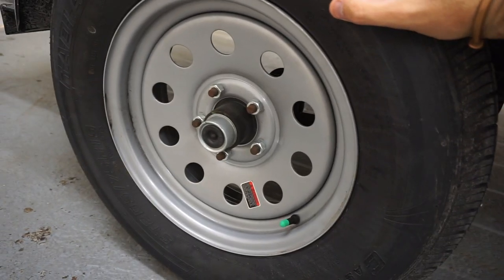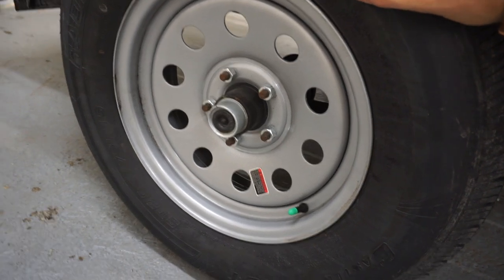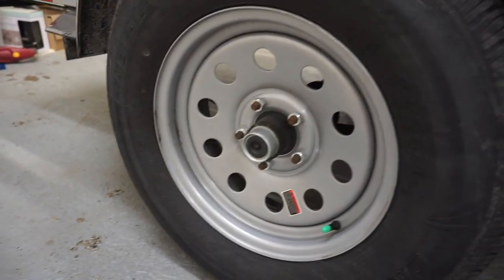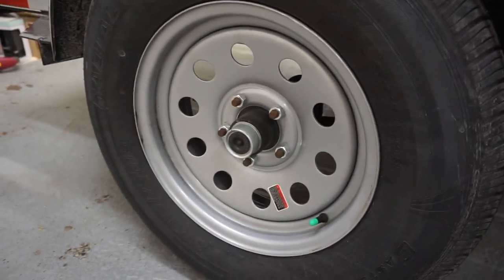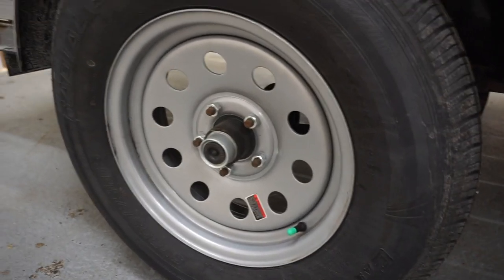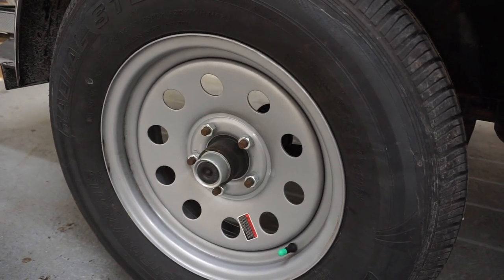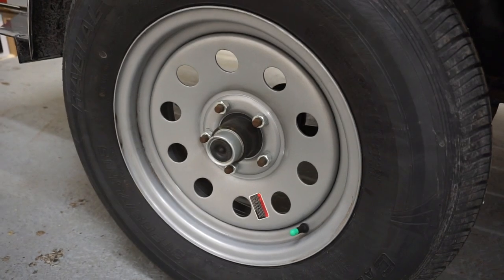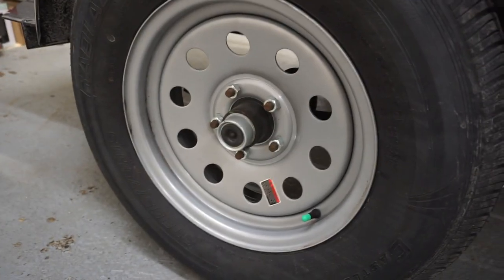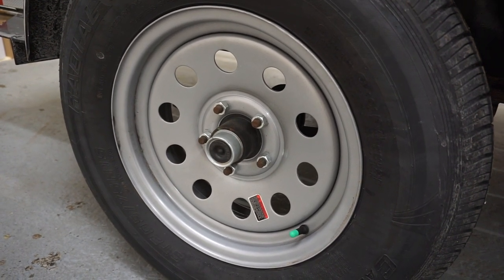For a trailer like this, you will also find trailers — the less expensive ones — that have much smaller tires, smaller rims. Those trailers will typically have a lower speed rating in terms of your ability to take them out on the highway, and potentially a lower axle weight rating. Look very carefully at that. This trailer is clearly a single axle trailer, and that axle is rated to 3,000 pounds.